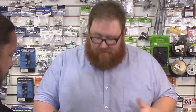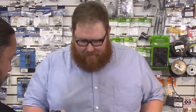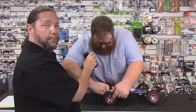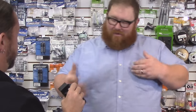Traxxas will tell you that if you crank it too tight, you're going to break all the gears — and yes, you will break all the gears. But it's a $5 to $7 part, and you're not driving this thing to work, so you don't need it to be reliable. That's essentially how you do it the manufacturer's recommended way. We're not necessarily suggesting the Roger way, but we're letting you know the Roger way. With it cranked all the way down, this bad boy is going to wheelie.